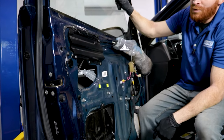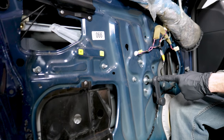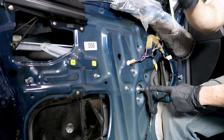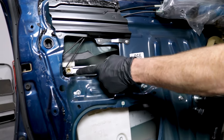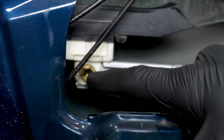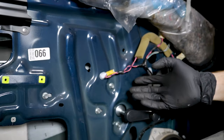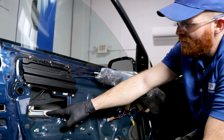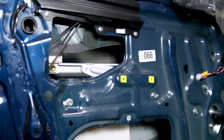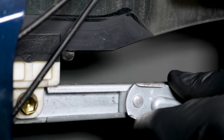What I want to be paying attention to is the areas on the metal parts where the window regulator is and see how much movement they have. As you can tell, this has quite a bit of movement — I can lift the window up and down without even moving the handle. That's telling me there's definitely an issue. So now, wiggling around the window, we want to pay attention to the area where the window connects onto the metal part of the window regulator. Make sure that bolt right there is tight. You're going to notice there's typically a second one behind the door someplace — if there's one, there's going to be a second.